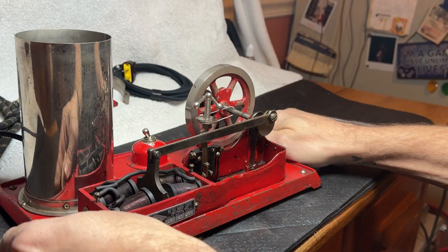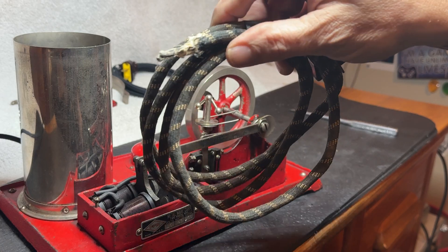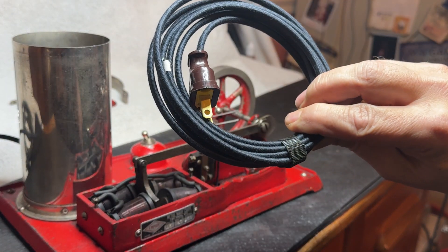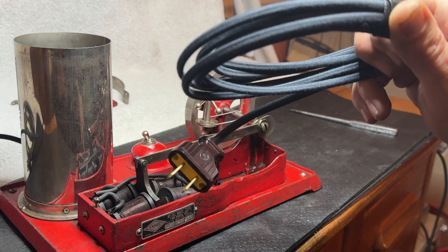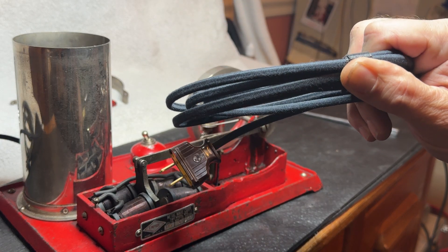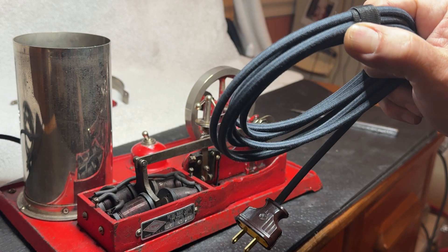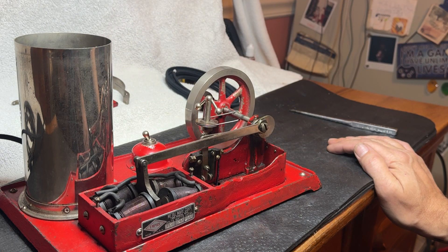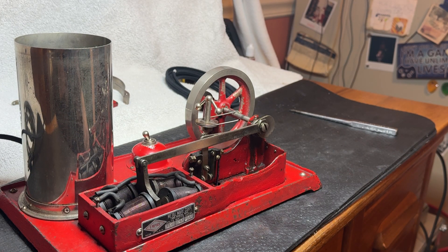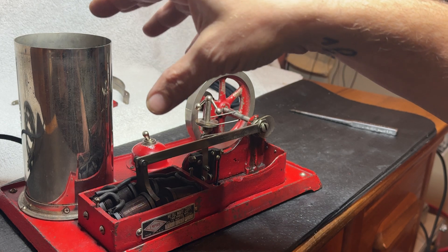So I'm going to put this back down. This is what I removed, and this is what I have replaced it with. I'll put a link to the website for this cord. In hindsight, I would have gotten houndstooth instead of solid black. This is a cloth, cotton cover over a modern power cord. It fits in nice — it's a little bit smaller in diameter than the original, but that's fine because it gives me a little bit more room inside the tank with the way the transformer is mounted inside.